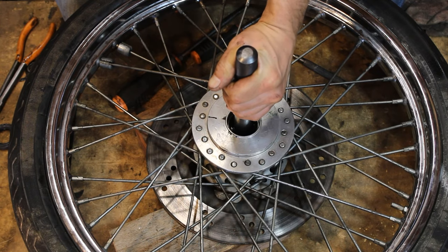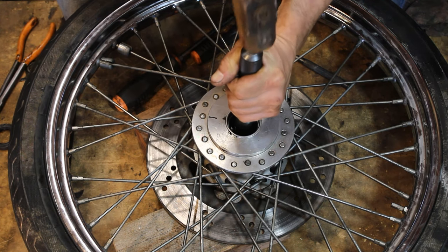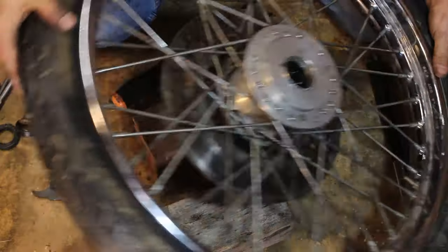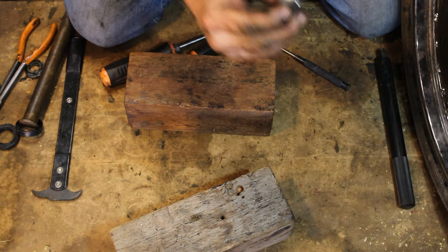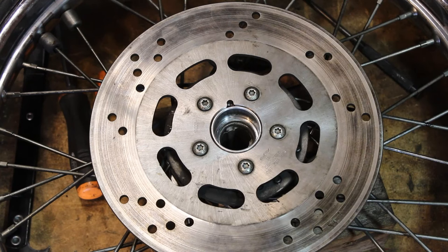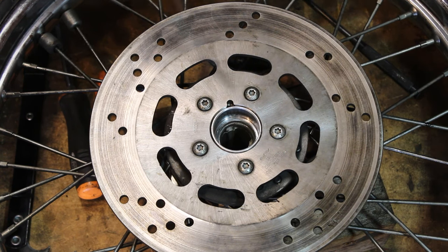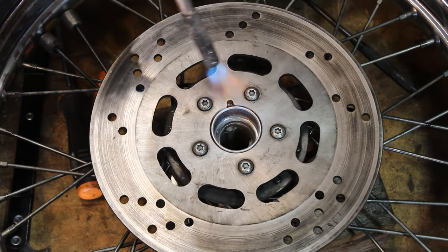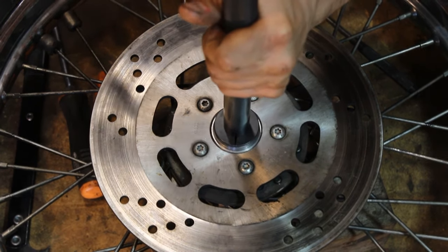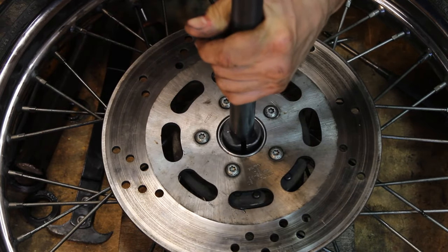You've got to use this special tool to drive out these Timken races, and this one is not wanting to play nice — I'm having to pull out the big ones, but we've about got it. See how this works: it fits on like this, then goes in and you drive it off. I've already got the new race on the installing tool. You don't have to do this, but heating it up just makes it easier. Right before I get it all the way to the bottom, I like to flip the tool over and get that last little bit.